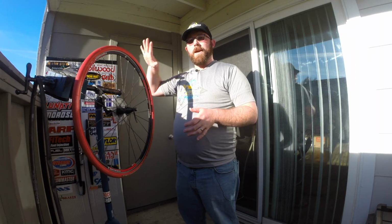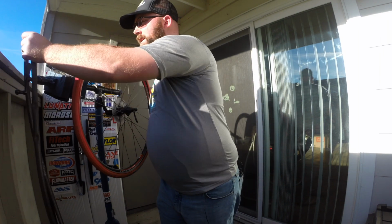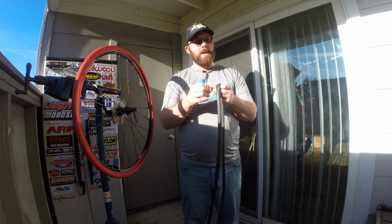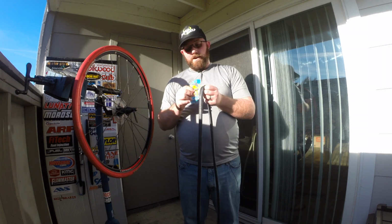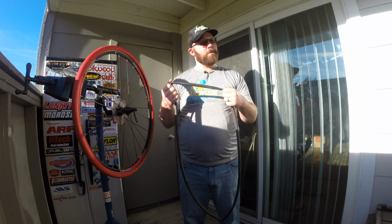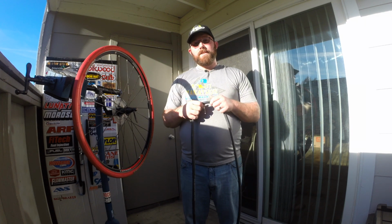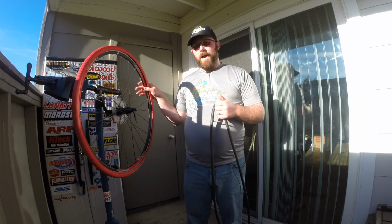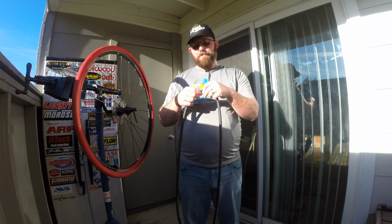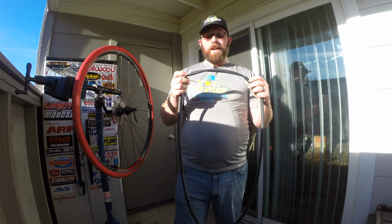All right, so you checked your tire, made sure there's nothing in there that's gonna puncture your new tube, and everything looks good. Now let's get your new tube. A lot of times when you get it brand new in a package, like a box, that tube is completely flat. It's very easy, if you put that flat tube into your tire, to get a pinch somewhere, so that when you pump it up, it pops the tube all over again. So the easiest way to do it is to get a little bit of air in here.